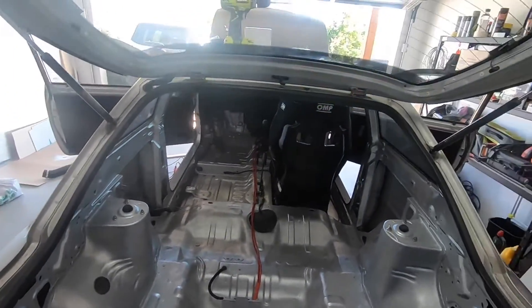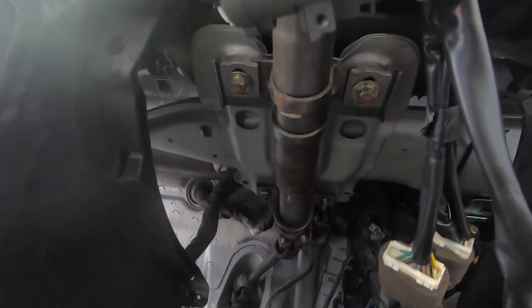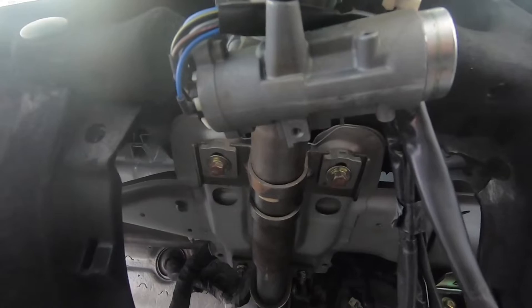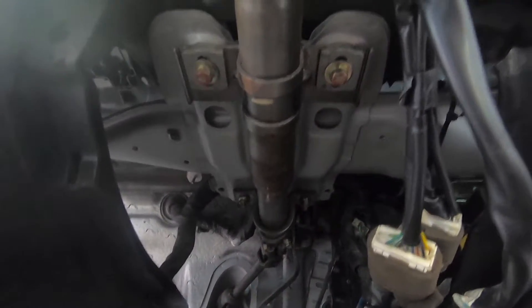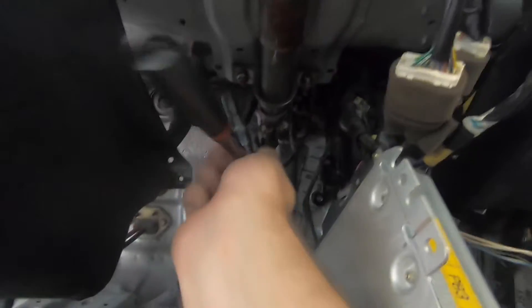Alright, so we're going to get the steering lock out. We've got to take the whole steering shaft or steering arm out — four bolts, two there and two down there. We're just going to disconnect it, probably just there — we'll have a look when we drop it down. I've just got a bit of a towel down here to protect the floor.